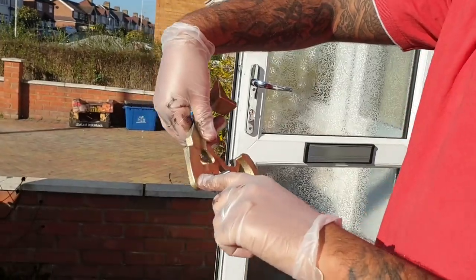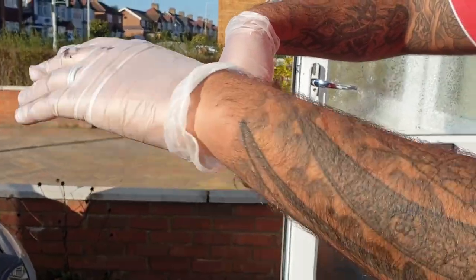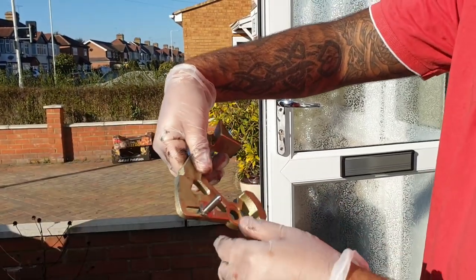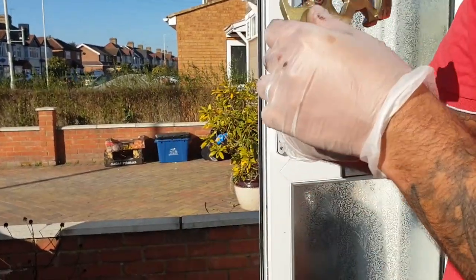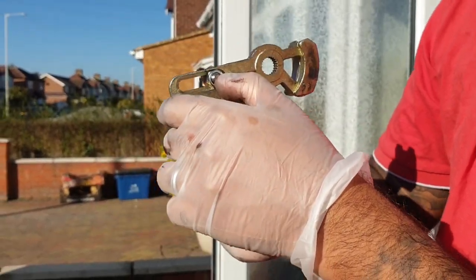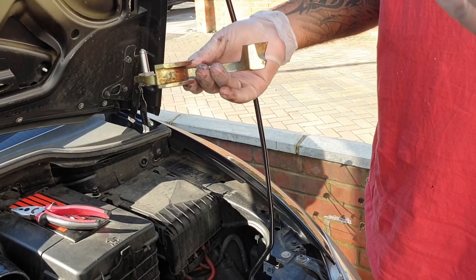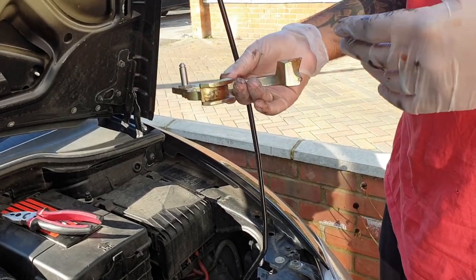Further to the left is a longer throw distance — so when you're changing gears there's more distance: first, second, third, fourth, fifth, sixth. Vice versa, to the right is shorter. We did it near the edge — I did it as far as I could over because I wanted short shifts. Some people said it feels notchy or clunky, but I don't mind. I want a shorter shift. Assembly grease is best, but most people have said it doesn't really matter.